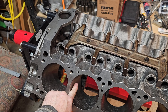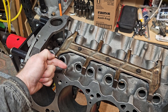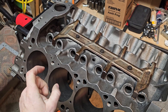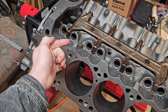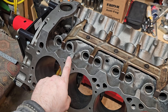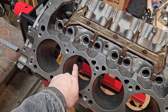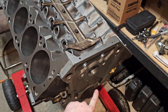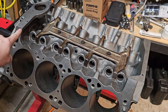I think what's starving the bearing of oil is the sheer velocity — at high enough RPM, the oil is moving so fast at the very beginning of its travel that it skips right over that 90-degree passage and actually creates enough of a pressure drop. It could even create a suction, theoretically pulling oil from the bearing. I don't know if it would go to that extreme, but at the very least it's creating enough of a pressure drop that the bearing just doesn't get enough pressure. The same thing could be true, just not as quickly, with number three and then number two, because there are still all these other bleed-offs creating enough velocity across that first galley.